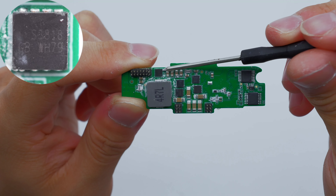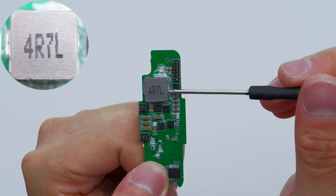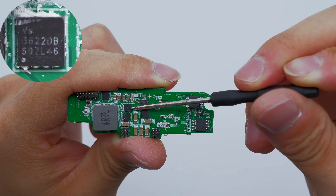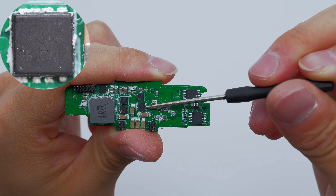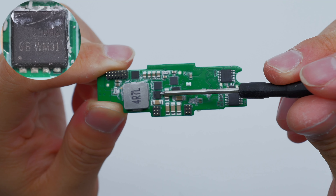The boost MOSFET is marked S3818, the same as the synchronous buck-boost MOSFET. There is an alloy inductor of 4.7 µH. The wireless charging power MOSFET is from Verdiga and adopts DFN 3×3 package — the dual NMOS is connected via a half bridge with a withstand voltage of 30V and conduction resistance of 8.2 mΩ and 6 mΩ respectively. Another MOSFET of the same model forms an H-bridge for wireless charging coil driving. The MOSFETs used to switch the resonant capacitor are marked S1008.